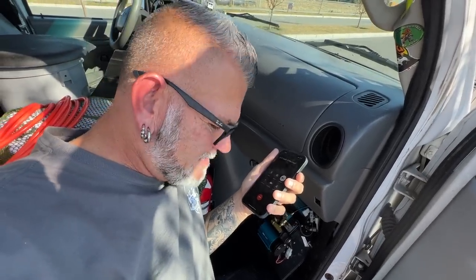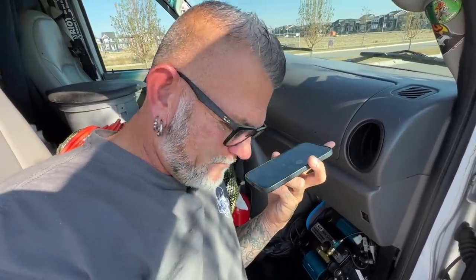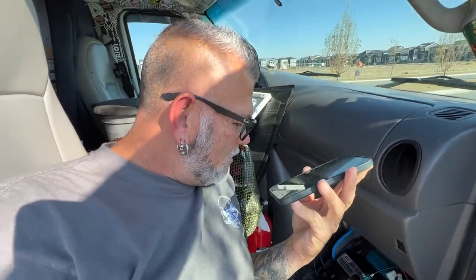Hello? Hey Doug, it's Chrome from Vancity Van Life. Oh hey man, how's it going? Good man, you got a second? I got a question. Yeah for sure, what's going on? So my air locker about a month ago — I think it's blown a seal in there because it's pissing air inside the differential. Yeah, so it's probably leaking out your vent too. Yeah, totally. But that air line coming back to my compressor is pissing oil out everywhere. I just noticed today. So if I unplug the air line from my diff, does that seal it?